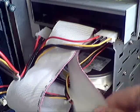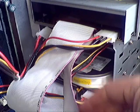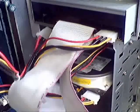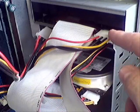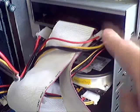From the CD-ROM drive it's going to go into the motherboard, which we'll install in a moment. Remembering that the pin 1 red line on the hard drive and on the CD-ROM is next to the power connector.